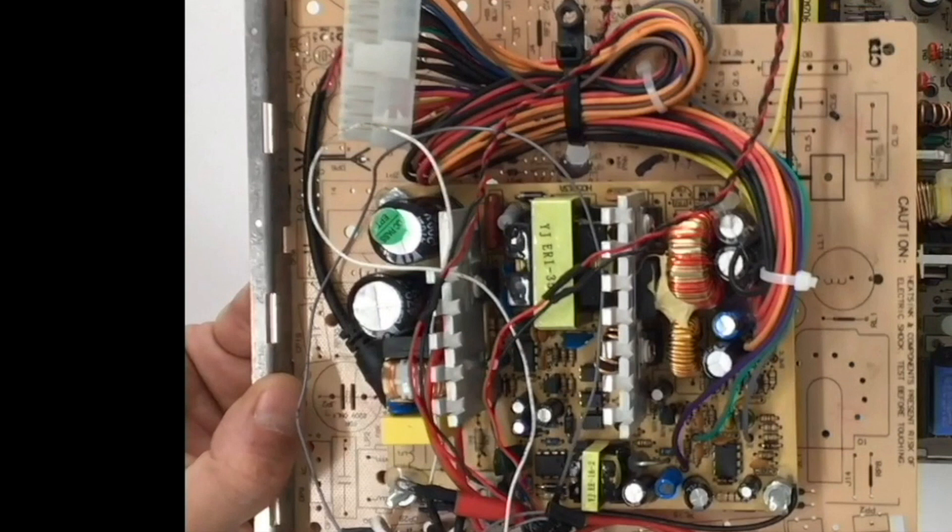Here's our power supply, mounted onto a Macintosh Classic II analog board where I stripped all the components off — nothing but a bare PCB. I took the housing off the power supply because it was interfering with the cooling fan and with the driver board for the LCD. I kept the full 24-pin ATX connector, and at 300 watts, it's more than ample to drive the iMac logic board and the LCD.